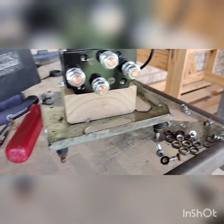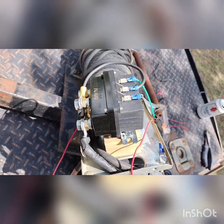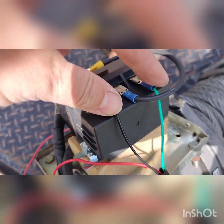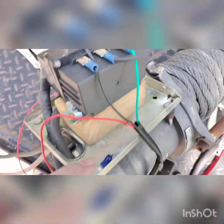All right, here it's all wired up. Left the cover off so I can go over the wiring. Controller power goes to the controller from down there - there's your wires from the controller, just the two outers. Three-wire controller: red goes right to the top, center one is ground. I tried to ground it to the chassis but it didn't work - I had to ground it right to the negative from the battery.